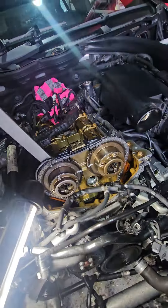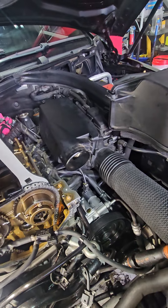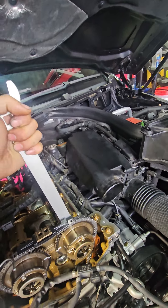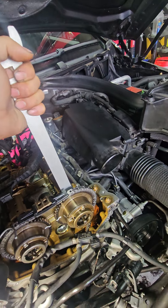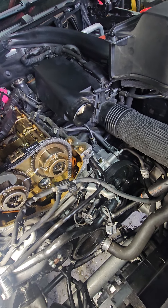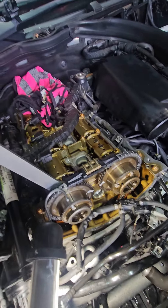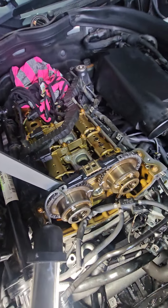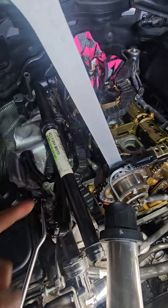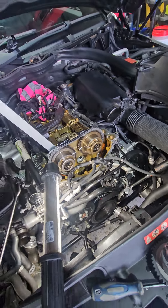This one can move, which is bad — you can't move the other one. So that's inside the cam adjuster, which has a spring in it, and it's just failed. If you keep driving like this, it'll actually wear out the cams or wear out the timing chain, and then you know, collapse it.